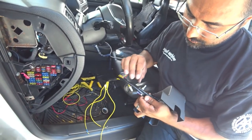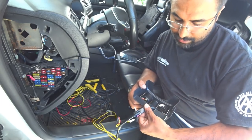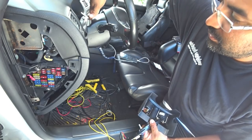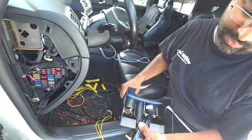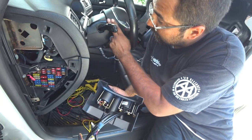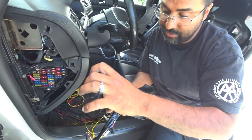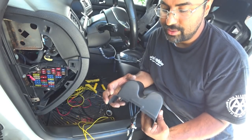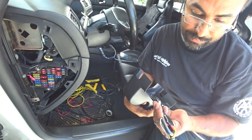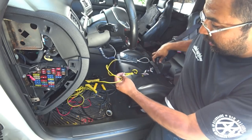Use a little electrical tape to clean things up on the back. When you wrap it back, try to make sure it's as flat as possible — that way the wiring doesn't bulk up and make it protrude on the back of your steering column, because then it'll look tacky. Make sure you clean the steering wheel cover as best you can before laying it on with double-sided tape so it doesn't bounce around. Make sure you run your boost hose and the rest of your wiring — we've got to run that O2 sensor.